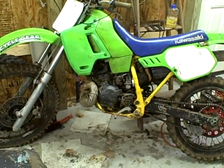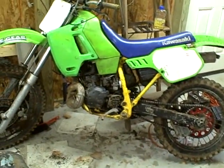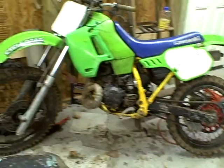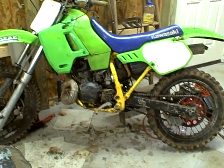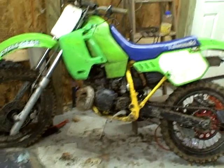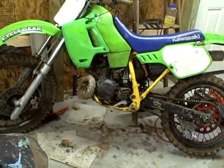What Still actually achieved was a near-perfect containment of air pressure for the two-stroke — what's called the air standard. At a 10 to 1 compression ratio, a gauge reads about 150 PSI, but this bike probably measures about 135 to 140 right now. If you weren't letting the heat out — because air always gets hot when you compress it — that pressure would be about 430 pounds at a 10 to 1 or 8.5 to 1 compression ratio. Still came close to that air standard of compressing air with none of the heat escaping, and the horsepower result would blow your mind.